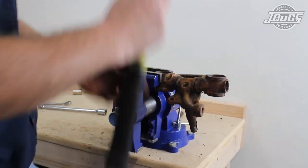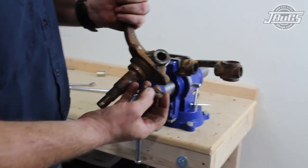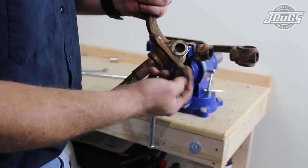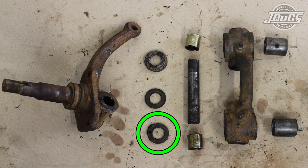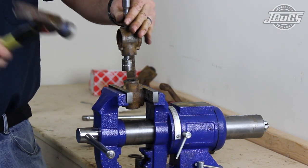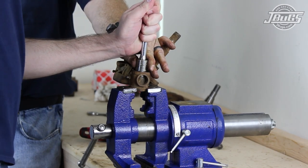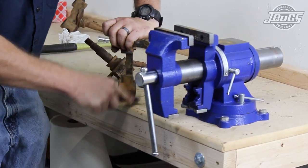The spindle can be slid or tapped out of the carrier in the direction of the grooves on the carrier. The dust cap, nylon bushing, alignment washer, and spindle all come out together. Save the washer and the spindle if you are reusing it — the cap and the bushing are not reused. With the spindle carrier still in the vise, a small extension and socket are used to tap out the upper and lower king pin bushings. Both spindle carriers are then cleaned up and ready for reassembly.